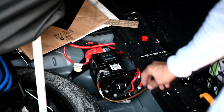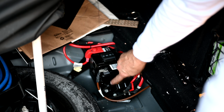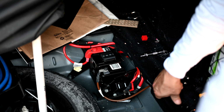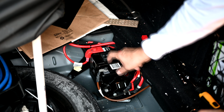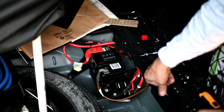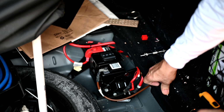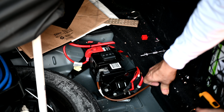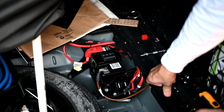Okay, now experts are actually kind of divided about whether or not you need to have a vent on these sealed AGM batteries. But the fact of the matter is there's a mat inside the battery that absorbs the hydrogen gas before it has a chance to escape. So under normal operation, there is no seepage of any gases out of this battery. Only in the rare case where there might be huge amounts of buildup, then a little safety valve might open up, but that's extremely rare.